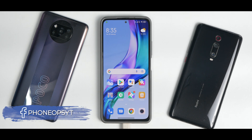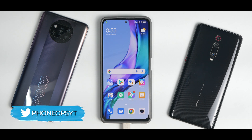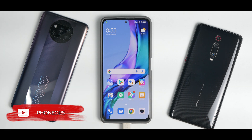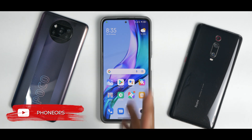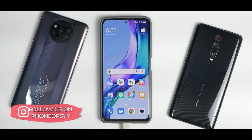Welcome to another video. Today we are talking about something exciting — MIUI 13 based on Android 12. We are talking about Xiaomi.eu, and until now, if you wanted to install this particular update, you had to connect the phone to your computer and install it using Fastboot. Now they have released a recovery edition of this. There is a specific Orange Fox version which is recommended that I've already flashed. I'll show you the step-by-step guide of how to install MIUI 13 based on Android 12 Xiaomi.eu on your Mi 11X.